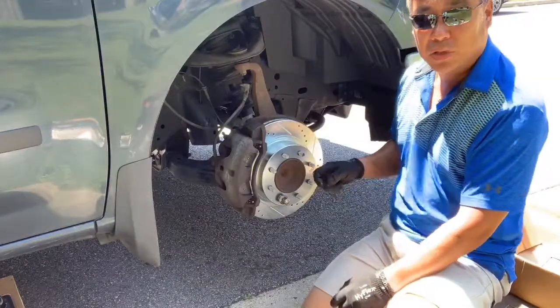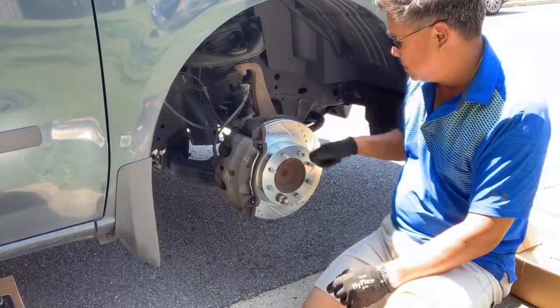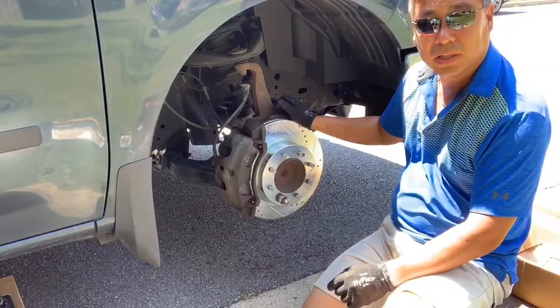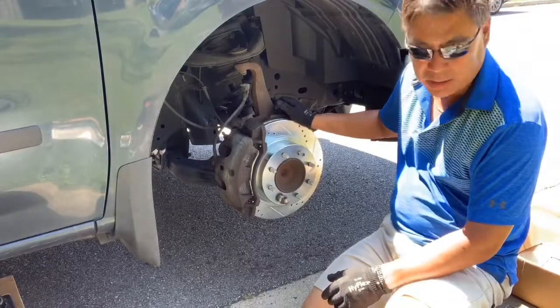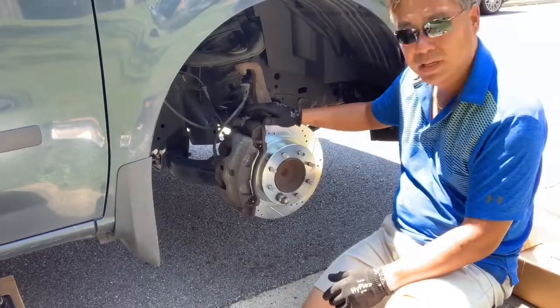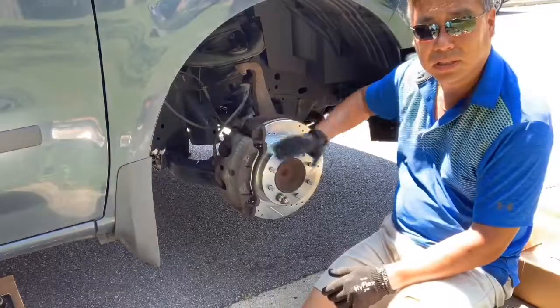One call out that I didn't do prior to the video is that I've already pre-cleaned the brake rotors themselves with some brake clean. Make sure there's no oils or any of that stuff from the packaging. If you don't clean them, what you end up getting is a lot of smoking, and at the same time the pads themselves are not going to be able to bed in with the rotors. The two of them have to cure together at the same time to be effective, so keep that in mind.